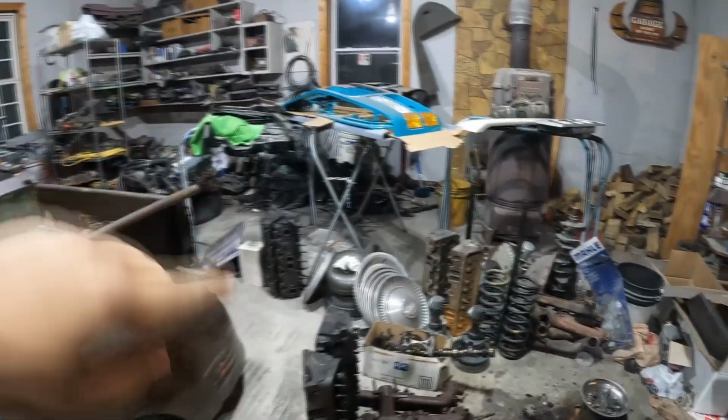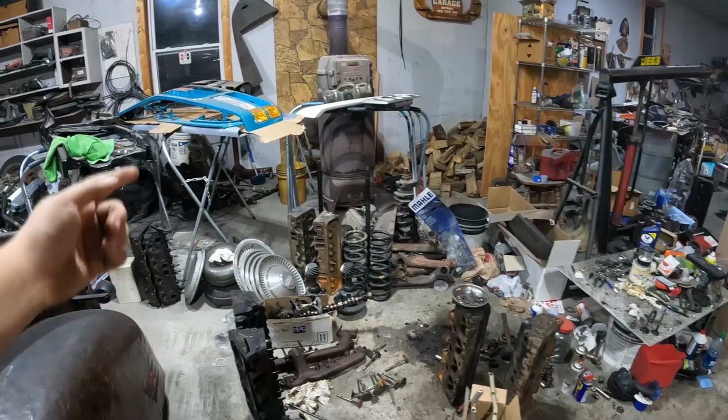That way, I mean, they're not hard to change heads. You saw how much room's in that engine bay. There's no way that I'm going to be struggling to do that. Even with a turbo kit, unbolt the headers and just lay them to the side, you got plenty of room. So I'm debating on just going ahead, not worrying about these heads, just clean them up and slapping them back on it. I've got an intake over there. I could figure out how to get it to work. I know the center two bolt holes on each side is a different angle, and you have to get a little adapter to do that. I may have an intake around here somewhere that has that already. I did do this once before, but I mean, just to get it by as cheap as I can without spending a whole lot of money on getting these heads done, that's what I'm thinking.